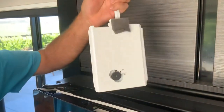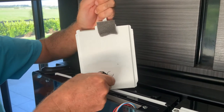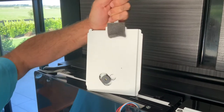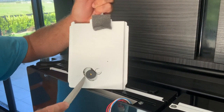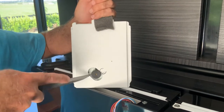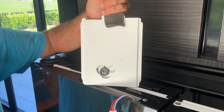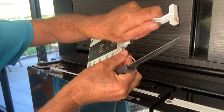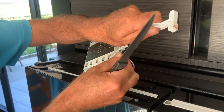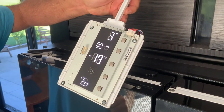In the back of the control panel you'll find there is a little speaker. You can get in there and flick that off — be very careful not to damage the underneath. It's very much like a battery. Now you've disconnected it, and when you plug it back in, she bursts into life — no more buzzer.